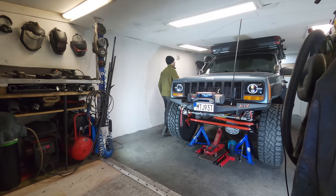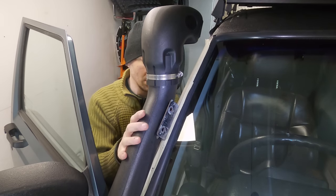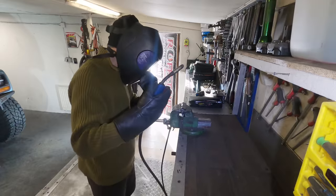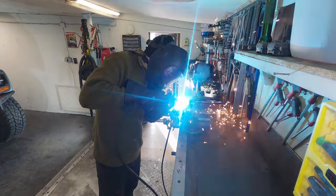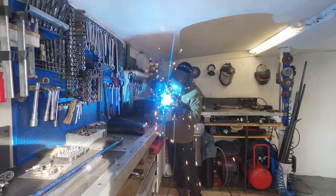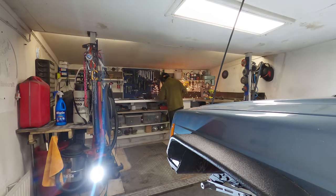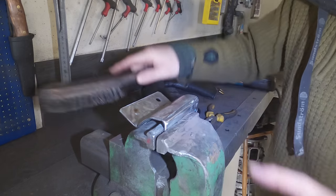I'm back in the workshop finishing up some of the smaller neglected details on the XJ. I've got a couple of fabrication projects I want to do, and the first one is to build a bracket to align and secure the snorkel. I've put this job off for almost two years, simply because I couldn't bring myself to drill into the visible sheet metal and ruin the paint. So my plan is to make a wrap-around bracket that clears the A-pillar and bolts behind the pillar, leaving the paint unscathed and the job reversible if ever I were to remove the snorkel.